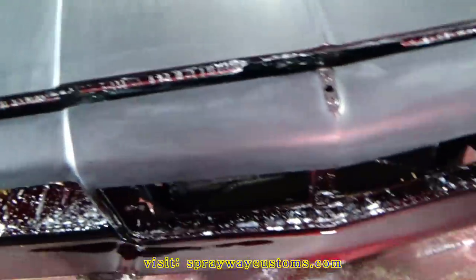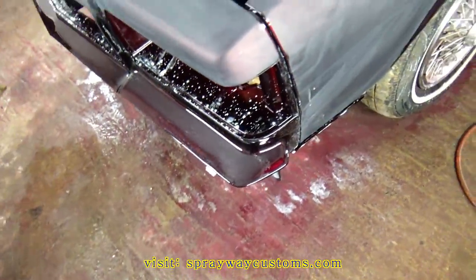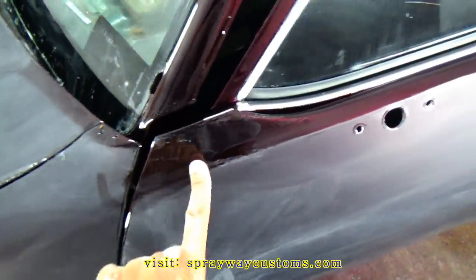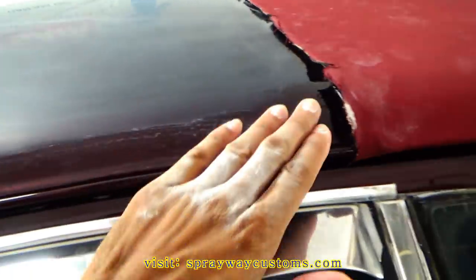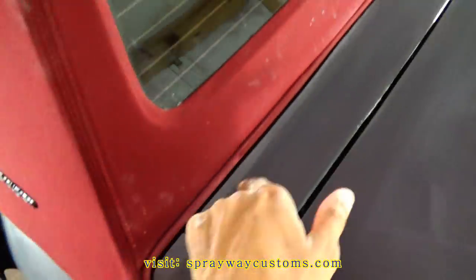The 2000 sanding is completed. I'm gonna walk you around the car, show you the areas I stayed away from. This here. Stayed away from this area here. Also around up in here, where the lock is gonna be. Didn't worry about this. Stayed away from here, all the way down the quarter top. You can see it, huh? I just did from here, back this way.